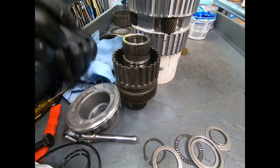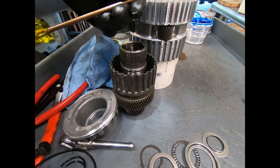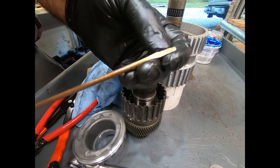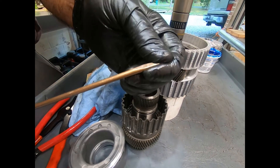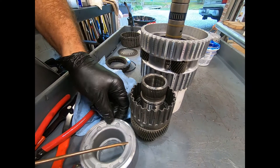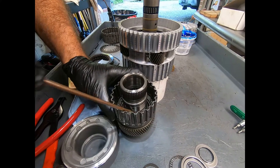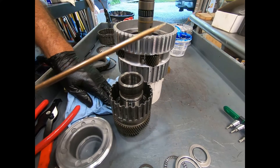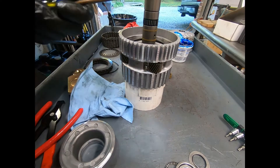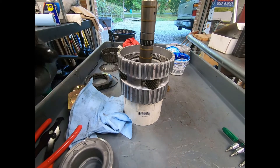One thing I like about this screwdriver — you might ask why would anybody want a bronze screwdriver like this? It's not very strong, it's easy to break. But it doesn't scratch steel and it's hesitant to mar aluminum, so it's very good for manipulation of snap rings in an automatic transmission. Also, it's explosion-proof — the idea is it doesn't create a spark when you're using it.